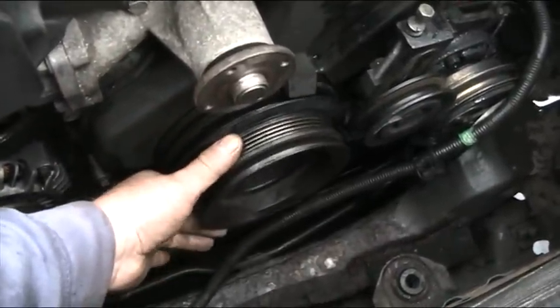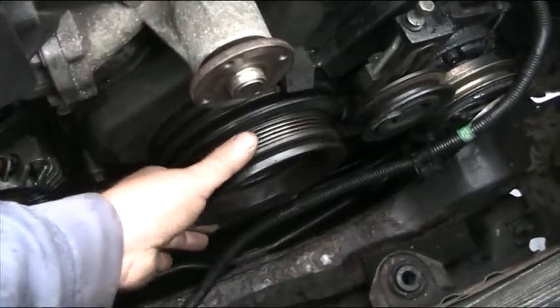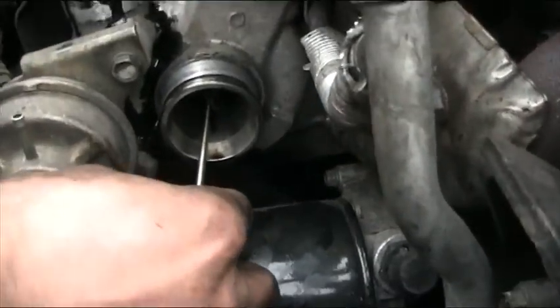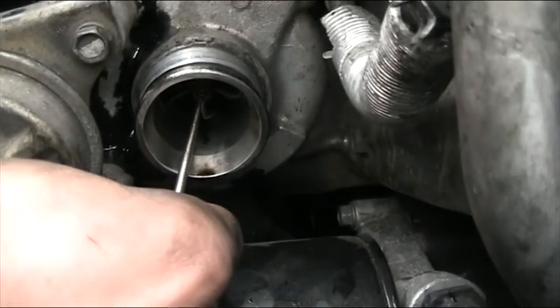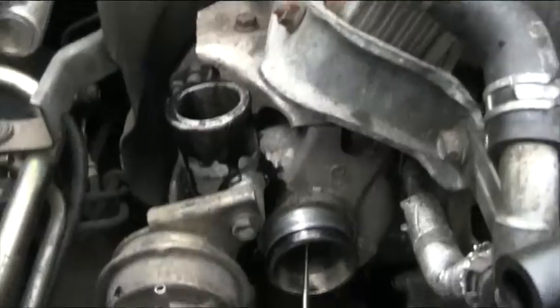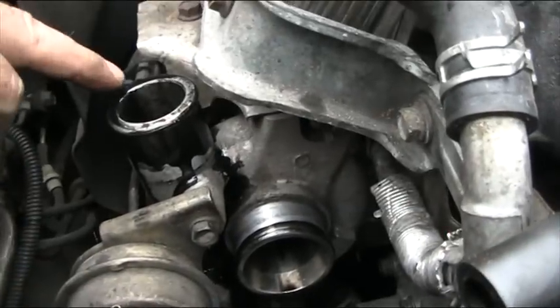It's got to be the worst one we've ever seen. Terrible — could have ended up on the road somewhere. Mr T has a demonstration of the loose bearing in the turbo where the shaft is worn. Give that a good wiggle — I hope the camera's picking that up. Another telltale sign is all the oil out the top of the turbo from the compressor side.